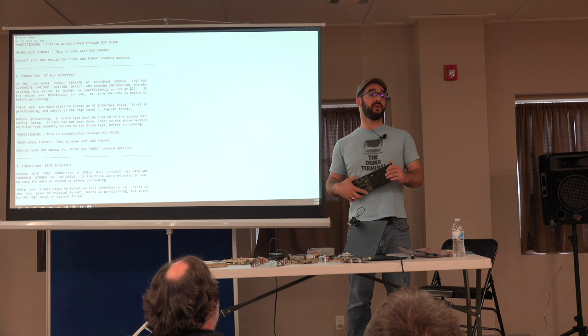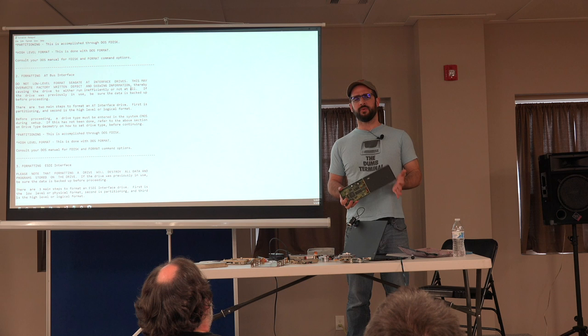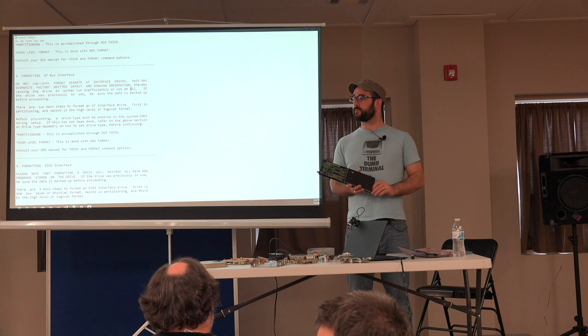Yes, there are utilities that allow you to park the drive, many. I'm pretty sure any PC voice coil drive that you're going to encounter is automatic parking. I don't think there were any that didn't, but I could be wrong. Another thing, I'm not sure if it's stiction or some other issue, but I've actually had pretty good success with sticking the drive in the freezer.